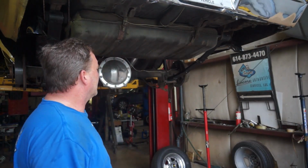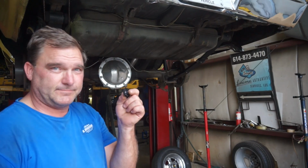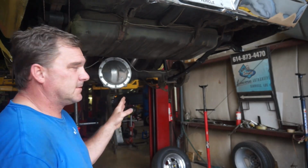So I'm whittling away at this Pontiac Ventura. I went ahead and started on the rear leaf spring that had not been changed previously because I figured they didn't replace it because they ran into a headache. And I was correct. The trapped nuts that hold the front spring pocket in place were all stripped. So I just cut the heads of the bolts off, changed the J-nuts out, put it all back together. That one's all back together now.